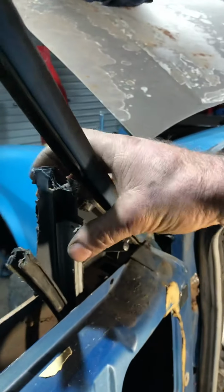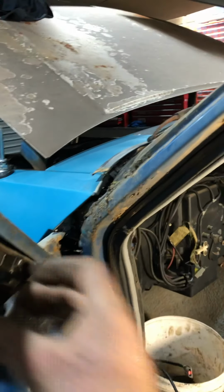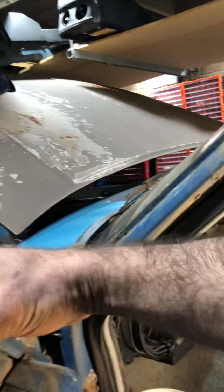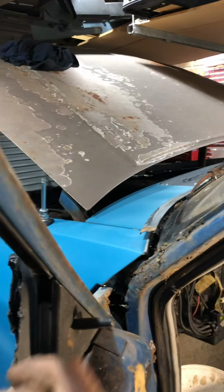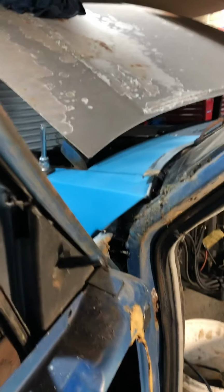Now, what I usually do is put this metal rod on first. I won't screw it in just yet. I'll just put it in first, pull this back a little bit. This inner trim will go on, and then you can slide the whole mirror back to where it's meant to be. Give me 1 second. Like so. And the mirror will go back, and then you can put the 2 screws in there, do the top seal, and your mirror will be all done and complete.